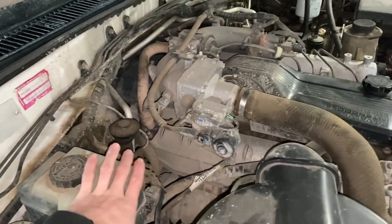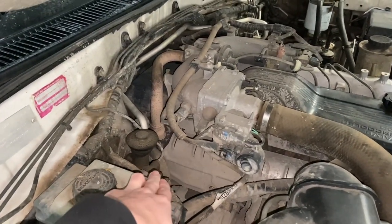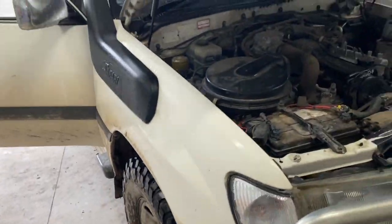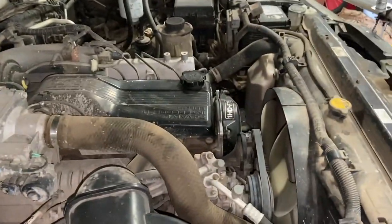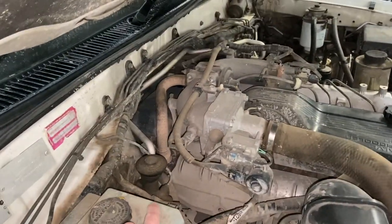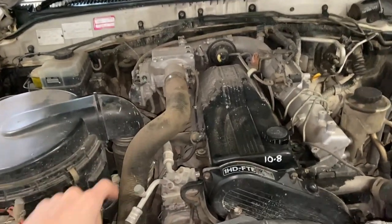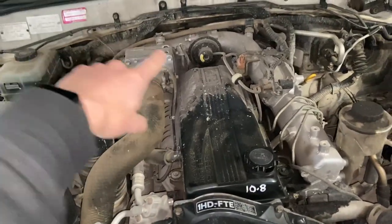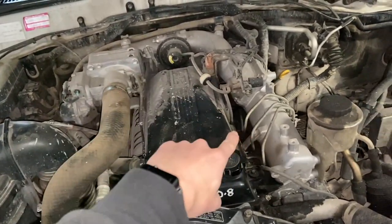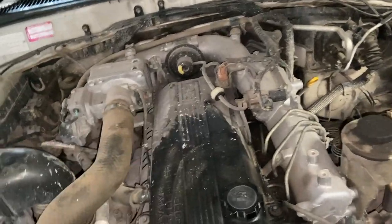It makes it greener. And well, these came in on the 1HZ in 2002. Correct me if I'm wrong, but I believe the first one of these was seen around 2000. So I imagine that the EGR has been on the 1HD block for most of its life. Now, the reason that this can lead to a power reduction is because not only is it throwing all the exhaust gases from the exhaust manifold back into the intake system, it's throwing all the soot and grit and grime with that from the engine.